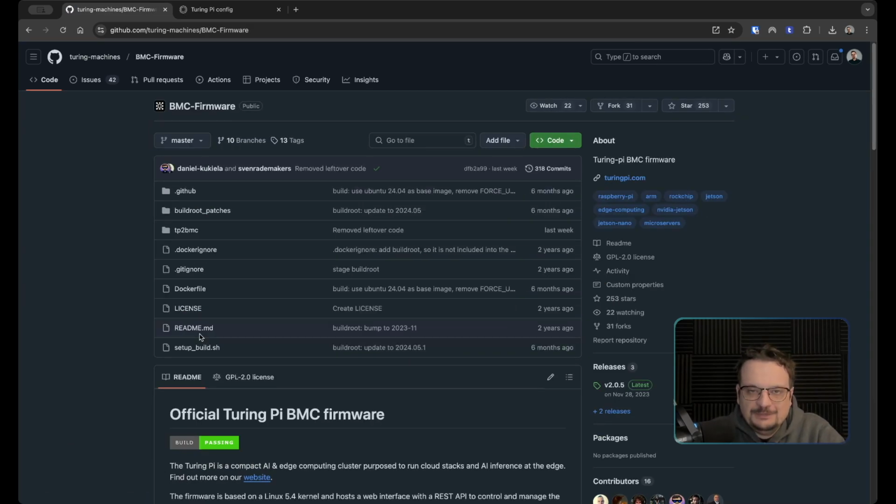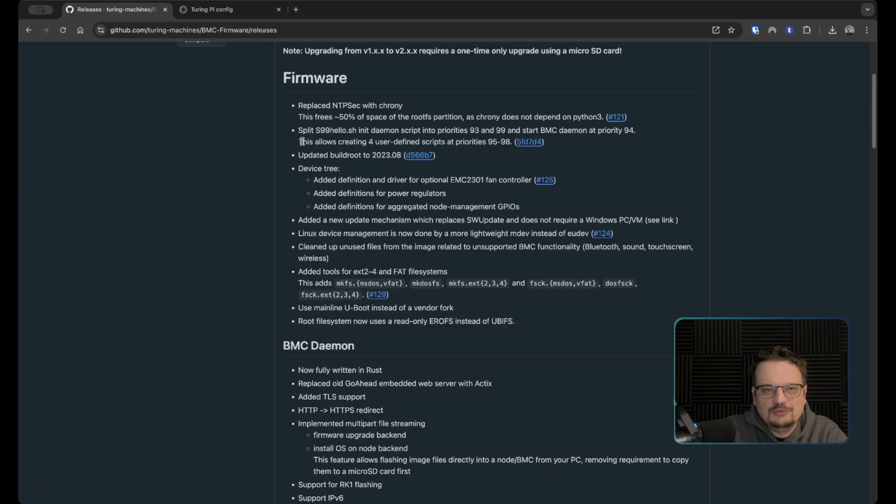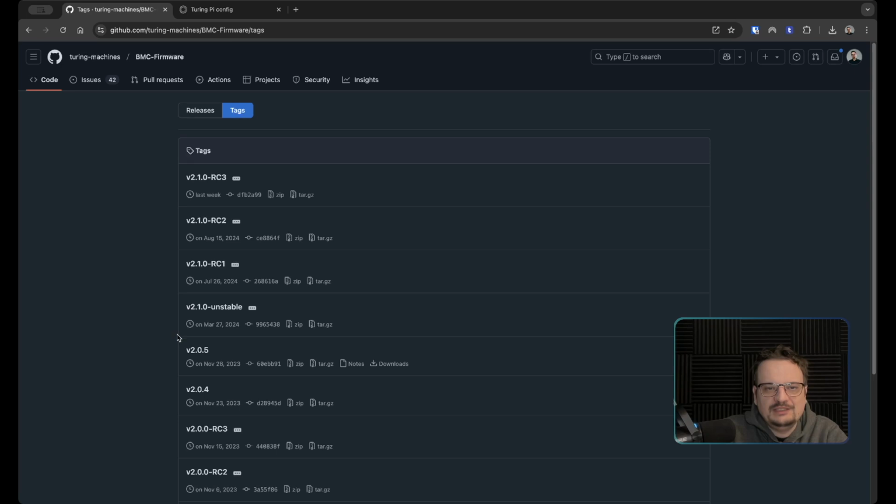Now, here's the thing. While making this video, there is currently a release candidate for the upcoming 2.1 version, which is actually the one I am going to install. I'm going to install release candidate 3. So that's not the full stable release, but I want to show you guys the new 2.1 release. Now, in order to find the releases, you go here to the right, you find releases, and under releases, you will find all the stable releases, the final releases. But if you go to tags, you can actually find the releases in between. So we are going to go for the Turing Pi release candidate 3.